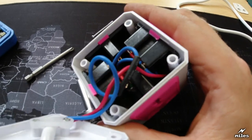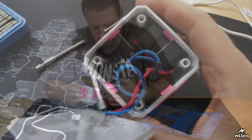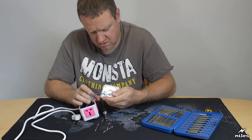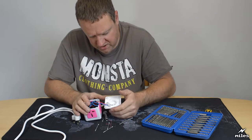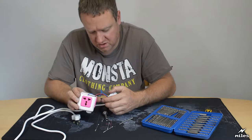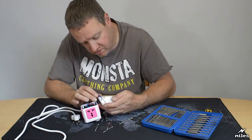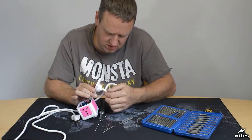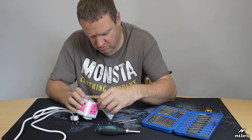Okay, well, first of all, most obvious problem here is there's only two wires. So it can't possibly have an earth connection. See, I thought that maybe the earth had a break in it somewhere, so it'd be sloppy manufacturing. But actually there is no earth cable, so it's been made deliberately dangerous. There is no earth connection in there whatsoever. Only got two wires. Oh, that's horrible.